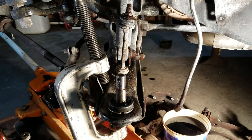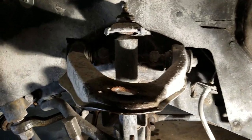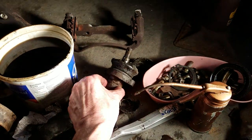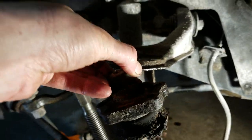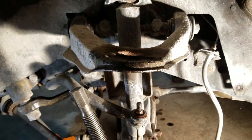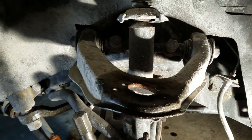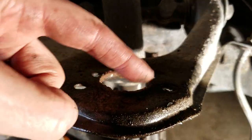The tricky part — the information I couldn't find out for certain — the upper ball joint is relatively simple to change. It's right here, and it just bolts in. Even though I took the bolts out and beat and banged on it, it still didn't want to come out. So I put the bolts back in loosely and whacked them a few times. A good hammer finally jarred it loose and you can see the rust here. Putting a little PB Blaster on there to soak would probably help.